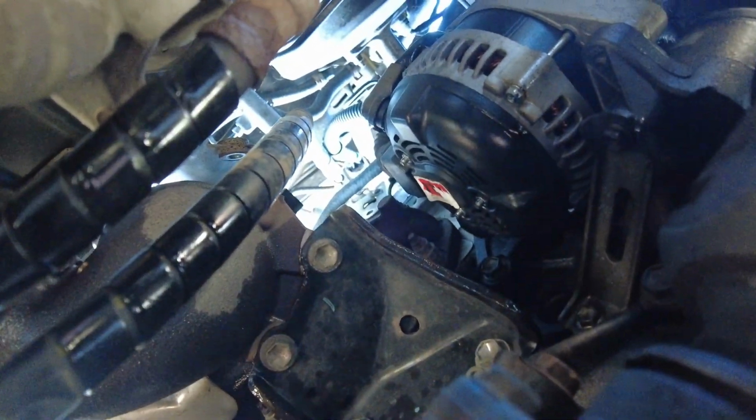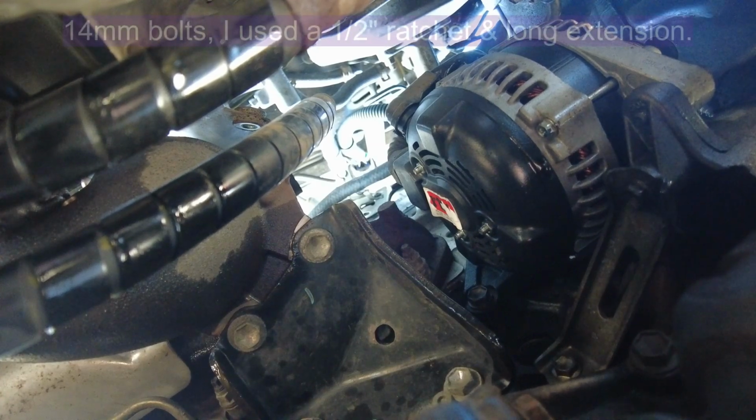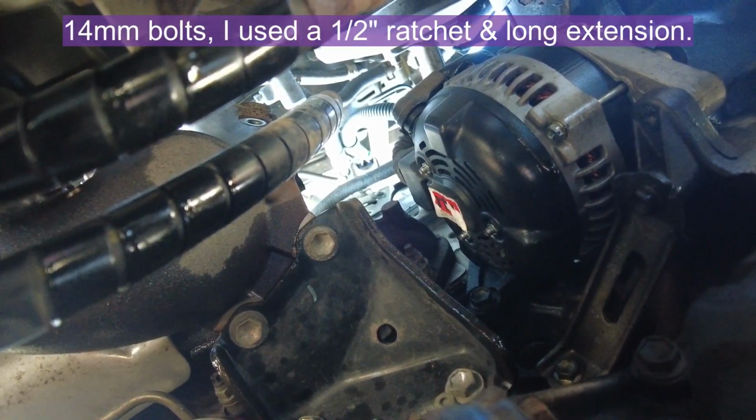So under the engine, under the sump, side of the gearbox, alternator's up there, look, you got these 2 nuts there, and they're holding the downpipe in place. So if you get those 2 off, got the 3 at the top, and then the 2 attached to the exhaust at the back, and our downpipe should come off.